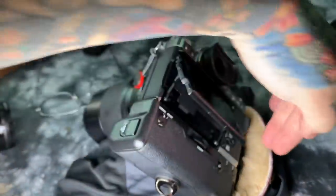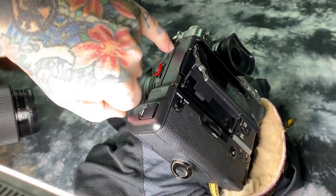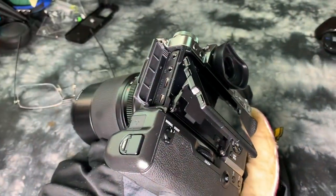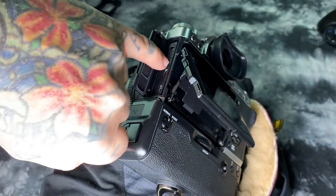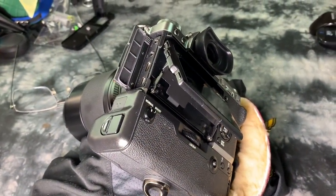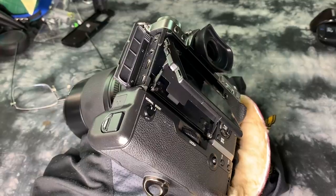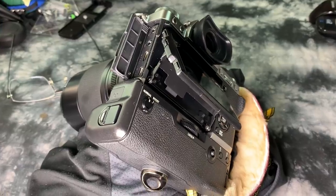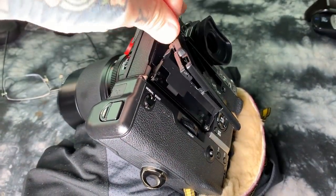No selfie screen can go off to the right because then the cable would extend too far — that's the grip area. And if you want to keep it flat, you can't have all these ports over here, because then the flexi cable or even a bundled cable like Canon uses has to attach to the main board behind ports that are soldered on. The reason you don't see selfie screens on many of these nice super-flat cameras — Sony, Fujifilm, Nikon — is simply a design issue.